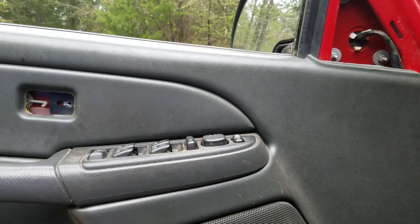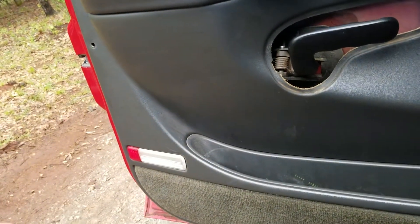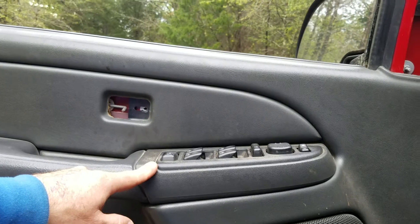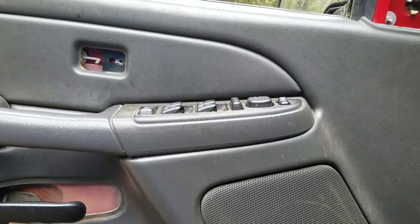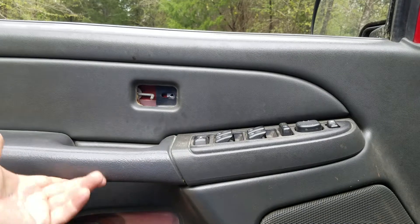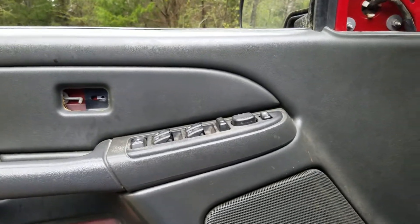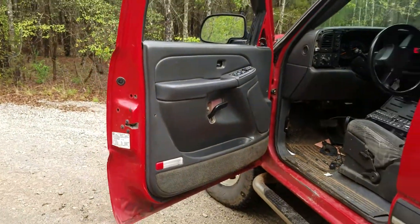When you get ready to pull this panel off, you've got to be careful because you're going to have several wires here, and one wire there — it's easy to forget about that one because you're focused on all these. Remember, that little connector just slides towards the front of the truck once you get the panel out, and these will just unsnap. When you think you've seen every quick little snap plastic connector, you're going to see another one. You could probably do this job by just picking up on the door and letting it hang just a little bit, but it's easier to just take the panel off so you don't have to worry about it falling and breaking a wire or a clip.